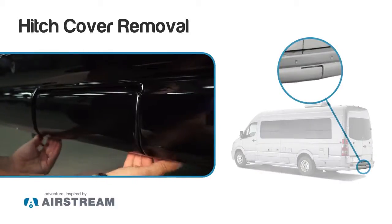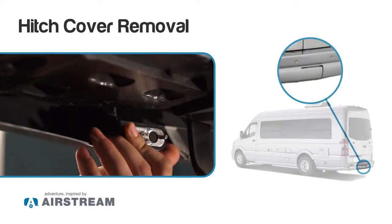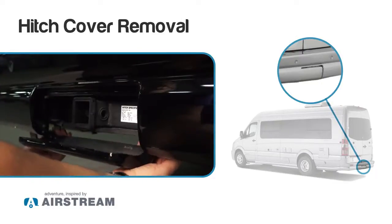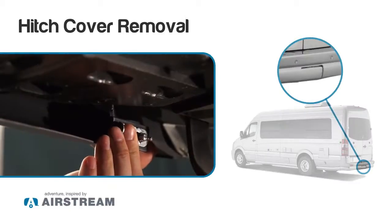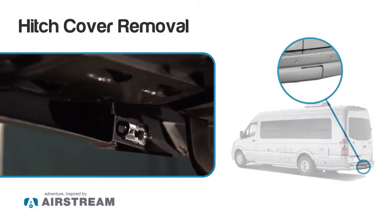Keep in mind that even though you're plugged in, the heating and cooling will not operate unless your engine is running. Removing our hitch cover: we have two latches on either side. We want to bring the locks towards the inside or middle; once we release those, push back on the little metal tab to pull the cover down. To replace it, bring it back up, bring the top in so the tabs come in, push them past the lock point, and then slide those locks back out over the pin.